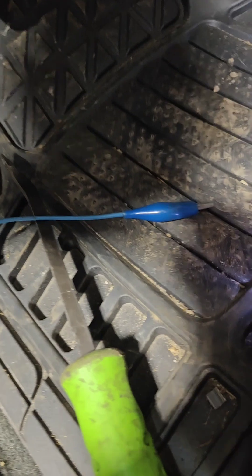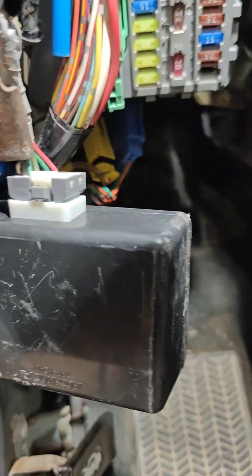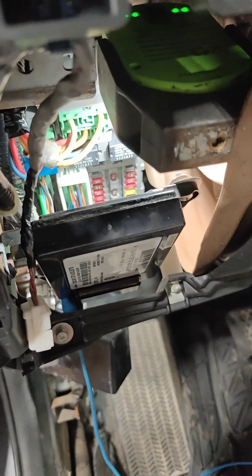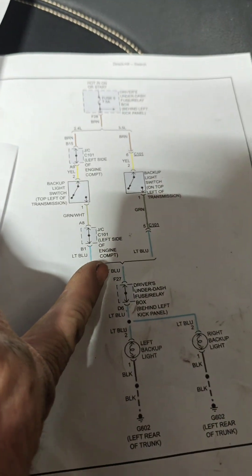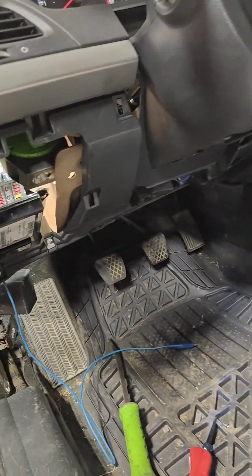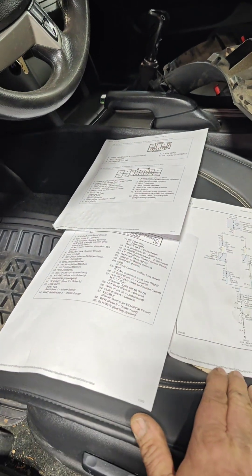We don't have a dead circuit — we have a bad fuse box. If I put this wire into here, there should be power flowing through that fuse box like it should, lighting up the reverse lights. We had just replaced this fuse box for a number of other electrical issues and now we're stuck with this. The repair is going to be one of two things: either cut and bypass the fuse box to make the circuit work, or get another fuse box. Either way, that is a completed diagnosis and we can move forward.